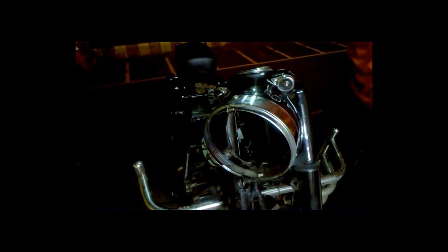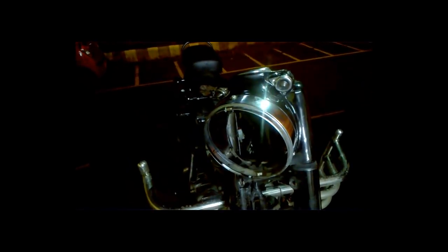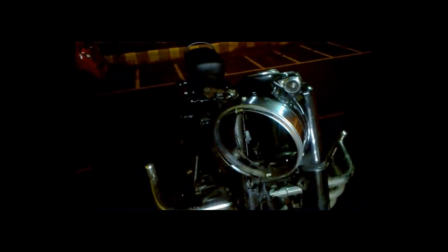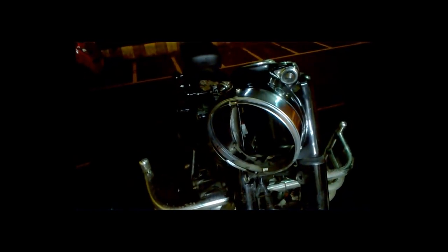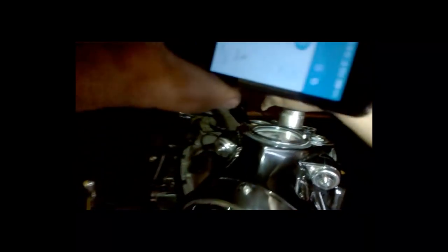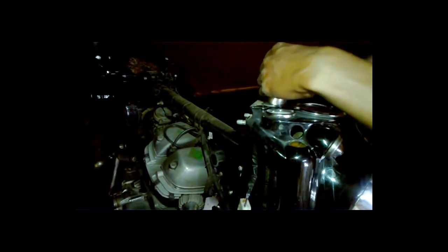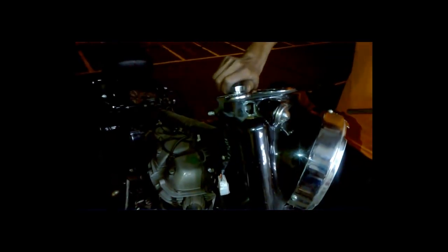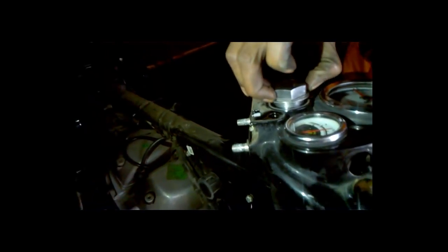The procedure for fitting the standard is very similar to the Thunderbird, but this requires a slightly different fitting since it's a very old classic conventional type of fitment. Royal Enfield is still running this old technology on the standard chassis. Now I'm going to remove the top dome nut from the stem — just remove the whole dome nut completely. Then loosen the pinching bolt and the whole unit will come out. There's also a small washer over there, so keep it aside and don't forget about it.